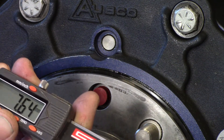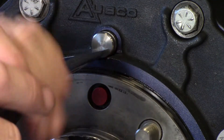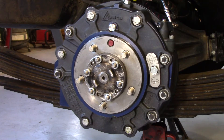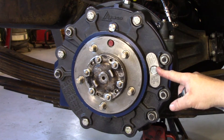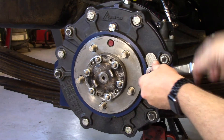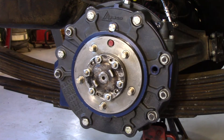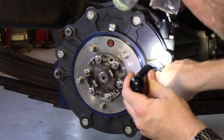Anything above 6.48 millimeters is fine to use. After taking the measurement, push your plug back in using the same flathead until it's all the way in, then go to the other side and take your depth measurement on the other brake. The next step is to check the brake oil by taking off the oil level port plug and examining the oil. With an 11/16ths wrench, remove this plug, then take your flashlight and shine it in. Your oil should be right up to the threads in the oil level port plug.